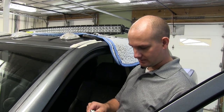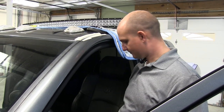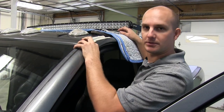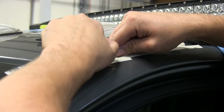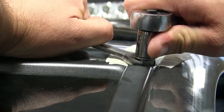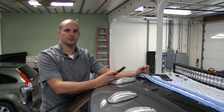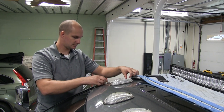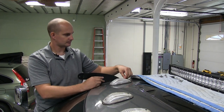Put a little bit of silicone around the insert, put it in your hole, and make sure it's flush with the top of the vehicle. Then crank it down. Once the holes are drilled and the inserts are in, mount the passenger side bracket: put the rubber gasket down first, then take your bracket for the passenger side, sit it up, and add the hardware.